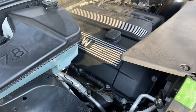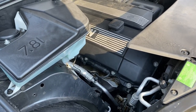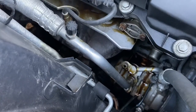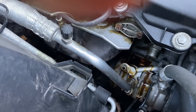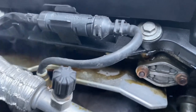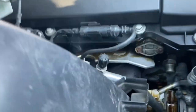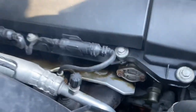Driving up to the garage this morning I smelt a very strong oil smell in the cabin, then looked in the rear-view mirror and I was being followed by a vast plume of smoke. I pulled over — I'm about two minutes from the garage — and I've ruptured something. It seems to be dripping from underneath onto the manifold, so I'm guessing it's some kind of cam cover gasket. I hope it's not a cylinder head gasket, but if it were there'd be water everywhere. Quite a lot of oil there — bloody Nora.